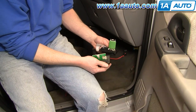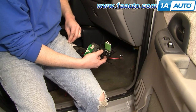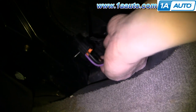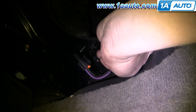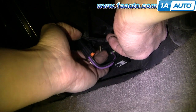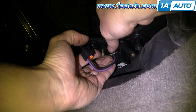I am going to reinstall the original one because on this vehicle it's working fine. I just wanted to show you that the new part from 1A Auto will plug in and will fix your issue if you're missing some speed on your fan. To put it back in, you put it up in and then get it to slide back onto those two rear screws — have those loose enough that you don't have to try too hard to slide it up in there. Once you get on those screws, it has some tabs that locate it. Hold onto it with your right hand and use your left hand to get that third screw that's easy to get to, and get them started.